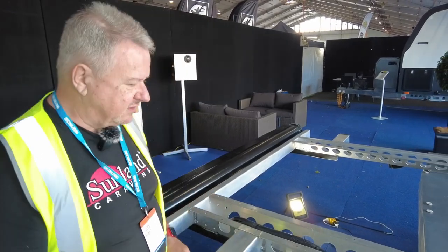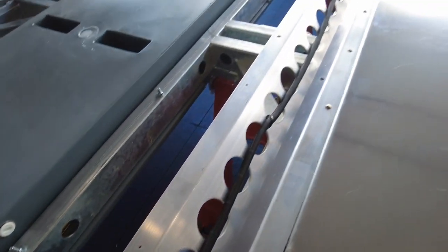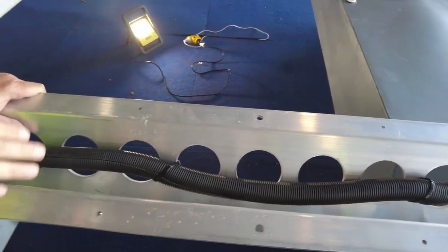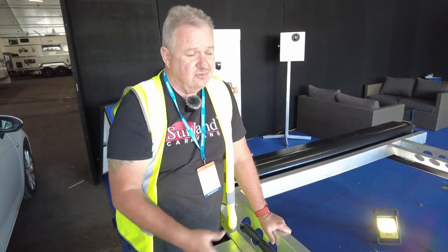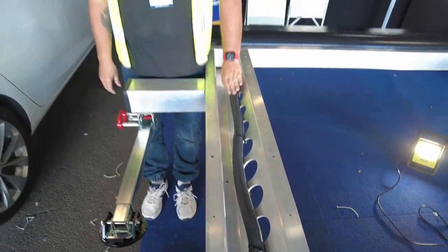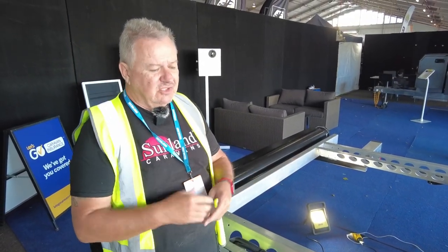You'll also notice we run the wiring through the channel. This one hasn't had it fully fitted for the show so we've used zip ties, but normally there would be tags all along here and the wiring loom sits on top of those tags. The idea is I don't want the wiring sitting on the base — if you get water, mud, or stones inside the channel it's really easy to flush them out, but not if wires are in the way. Bringing the wires up high also means the entire wiring loom is well protected and accessible if anything goes wrong.